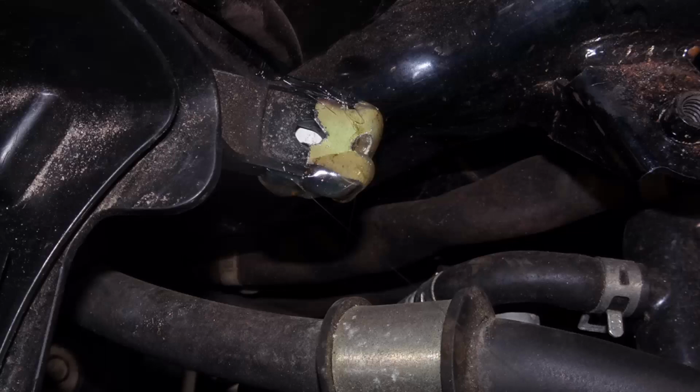I first tried it on this metal clip on a motorcycle. I had to make my own metal clip, so it wasn't tempered steel. The original one was lost. So I just bent the normal soft steel into the shape I wanted, drilled a hole in it. I put the screw in place, but I didn't tighten it. I just ran the screw down in there. And I just took a hot glue stick, heated it up, and just jammed it around the clip. And you can see how it just flows around everything. And it's real hot because it's hotter than the glue gun makes it. So it seems to bond quite well.